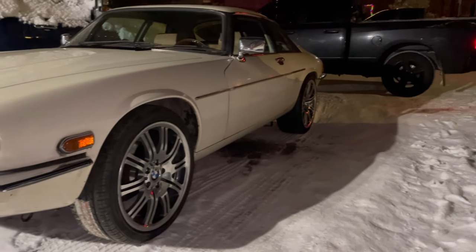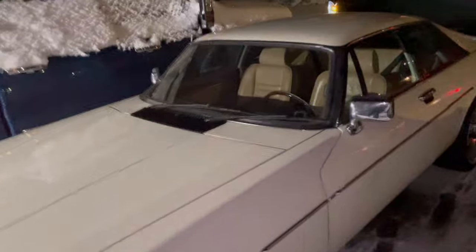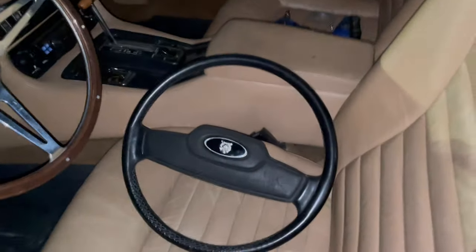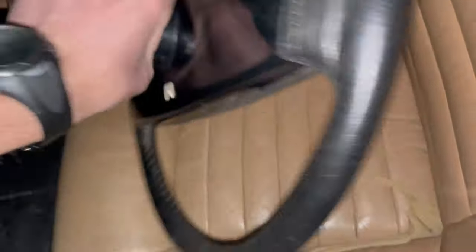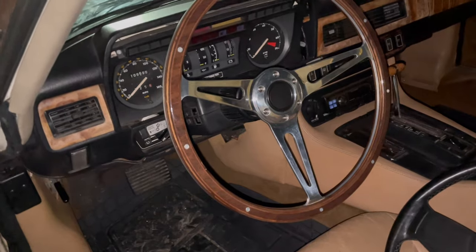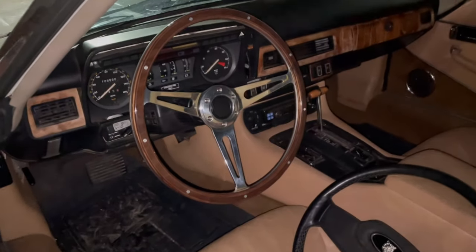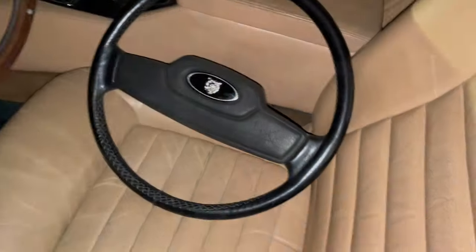Really get a good look and pan of the car. Let me show you guys the steering wheel that got installed — there's the stock wheel for comparison. My car is a non-airbag car, so this was really easy to install. All you have to do is take out those two flat heads that release the horn pad, and then the center nut — I used a socket and just impacted it off. Then you slide over your adapter and bolt up the wheel. It looks really good. I did order a Jaguar growler horn button for the horn button — it will look just like that.